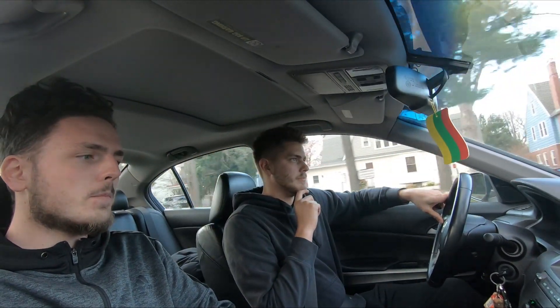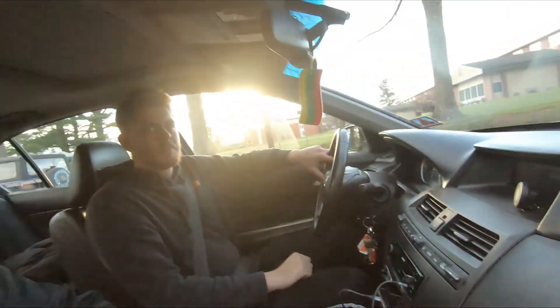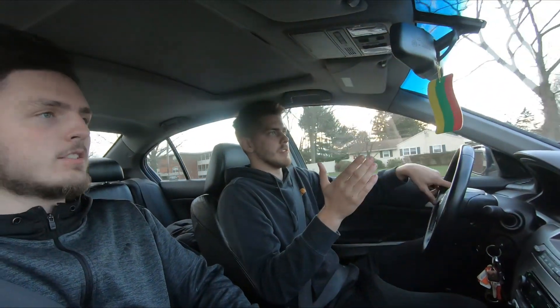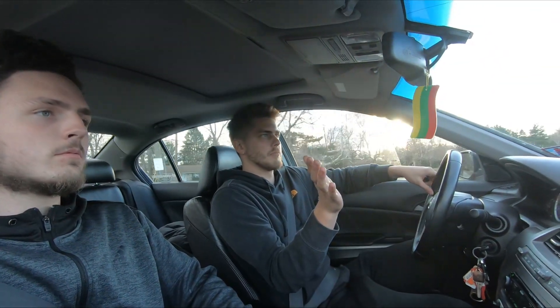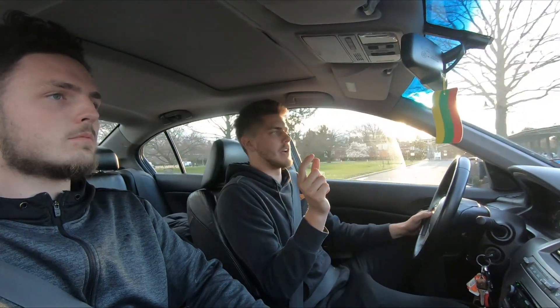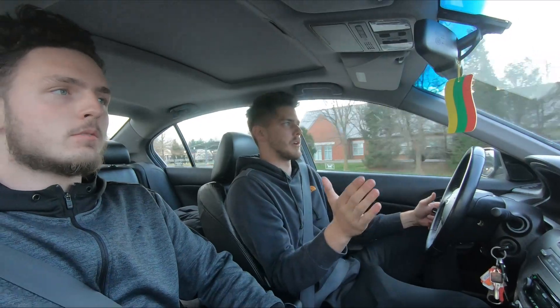Montez has had the sound system for about 10 months now, close to a year. I can already tell the difference is crazy — you can't really hear much of the outside, but the amount of bass that's now kept in the car makes some songs really bassy. As before, I always joked about how he didn't have that much bass. There's clearly a visible difference — a lot more bass is kept inside the car. It's not escaping through the doors or the trunk because bass is lower frequencies, and lower frequencies pass through solid objects more easily. Now that there's sound deadening, there's more thickness for the sound to pass through, so it has a harder time leaving the car — it keeps the bass inside and it sounds a lot nicer.